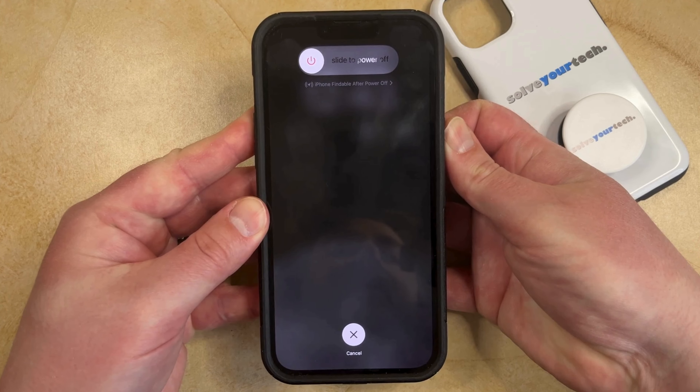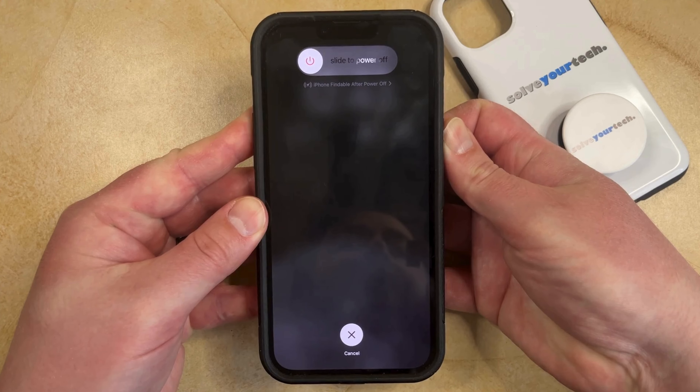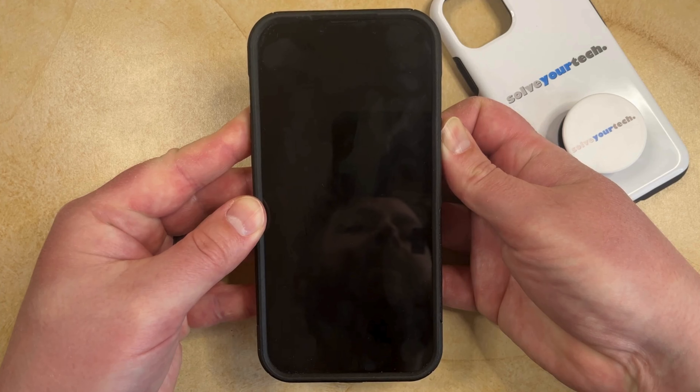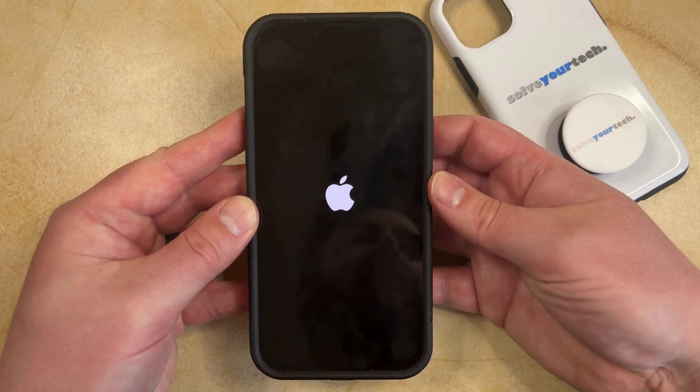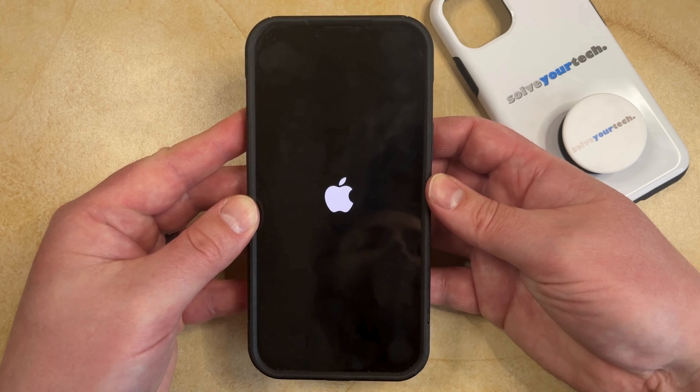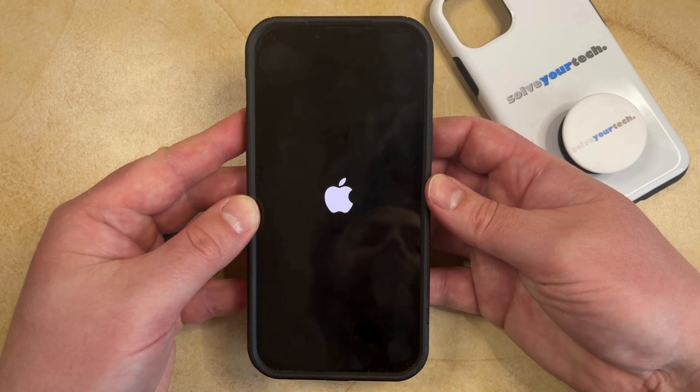Now this is going to appear since my phone's screen isn't frozen or stuck, but it's going to black out here in a second. And then I'm just going to keep holding the power button until I see that white Apple logo appear, and then you can let go of the power button, and then the phone is going to continue rebooting, at which point you'll be able to enter your passcode to get back into your phone.